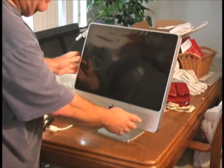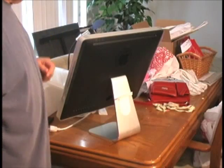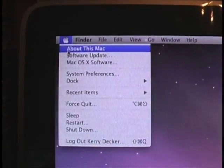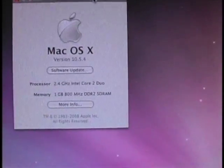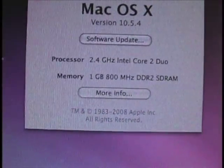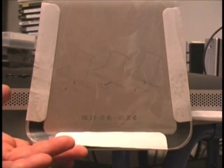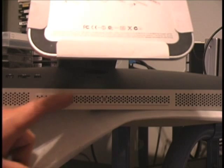Let's go about and put the memory in, which is done here on the underside back of the screen. For those of you planning on upgrading your Mac — click under Apple, and then 'About This Mac.' This little screen will pop up, and as you can see right here on the bottom, it says there's one gigabyte of memory in it. That will tell you where you're going to start. After we put in the memory, it should read a higher amount — in this case, two gigabytes. We're going to lift this base hinge up, which allows us to get to the bottom where the memory is.